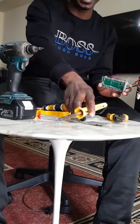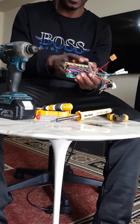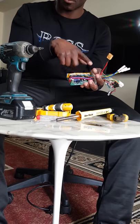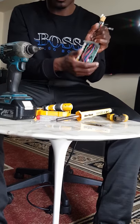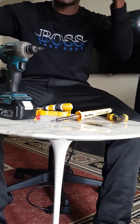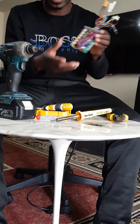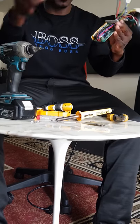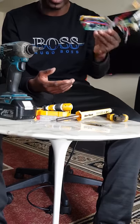When they pull that one out, there's going to be a number on it. If you're going to be replacing it and you don't know what it is, you can go on Google, put in the number of that MOSFET, and trace which company can supply it. Or sometimes you can go on third-party places like eBay, Facebook and so on. People are always selling stuff. You might find somebody with a good one, maybe from something that's broken on the scooter. You can buy it to replace this one and then put it back into your controller and get things going.